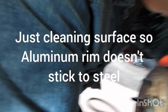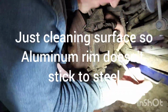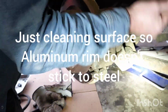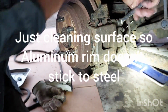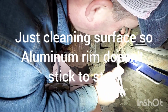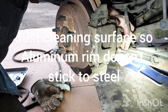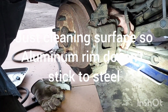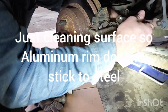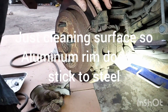What'd you do? 13 ratcheting wrench. There's a socket. That one. Just make sure these are all lined up. Okay, now, torque spec on these is 35. But what do we do, Brian? What happens when we're going down the road in the Chevy pickup truck and we let the guys do it? And the caliper rolls flat. So, boom. Just a light tap. Like that. So you don't have to stop and ride the jack and switch the bolts from top to bottom so you can drive home.